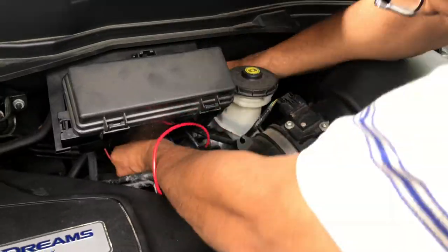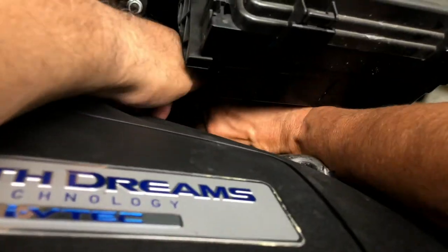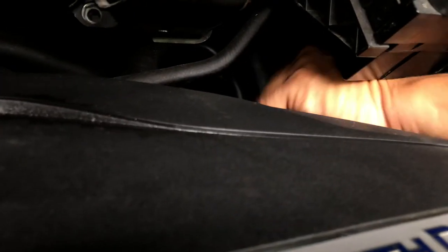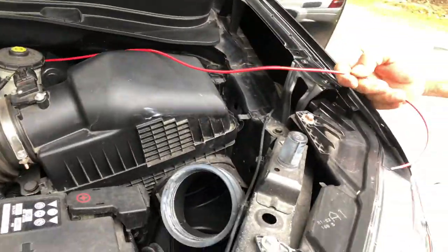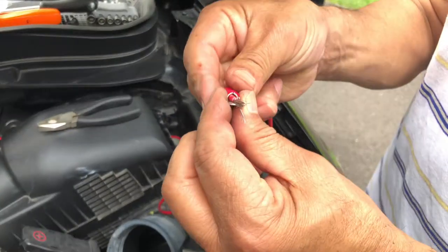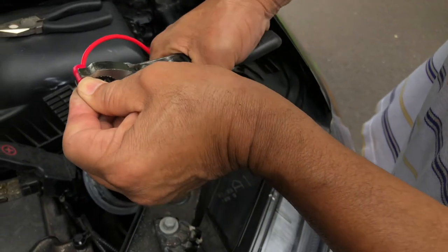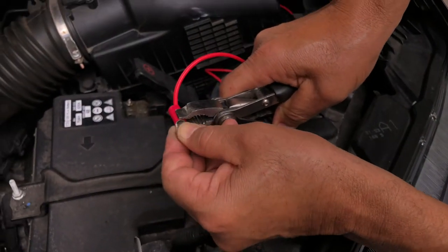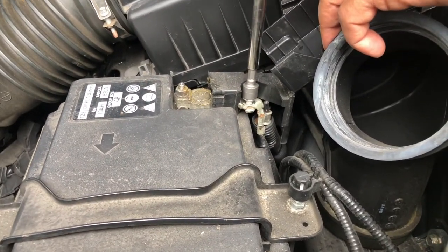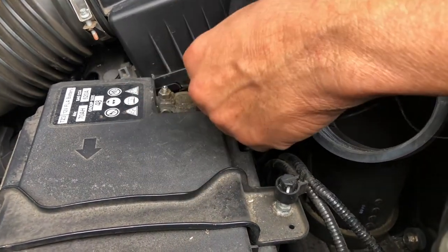Then address the cable as you choose. I chose to guide the cable around the frame of the vehicle, far away from the engine. Remove the rope and use one of the included terminals to connect to the battery. Connect the power cable to the positive terminal on the battery — please make sure that while doing this, the negative terminal on the battery is still disconnected.